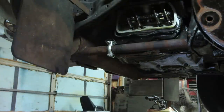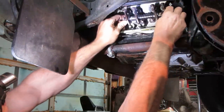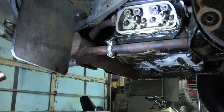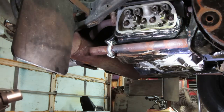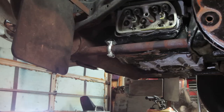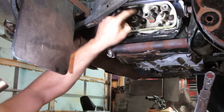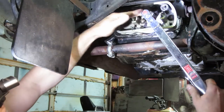In this much of an older motor the hardware setup is a little bit different — it's all similar though. I'll just get the whole assembly right out of our way. The head bolts should be 15mm. If you're torquing the cylinder head you would use a pattern — usually start in the middle and work your way out — but again we're just looking to see if this takes anything. The torque wrench is set at 25 already.